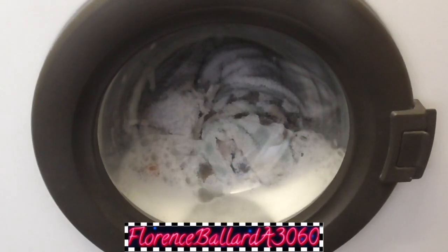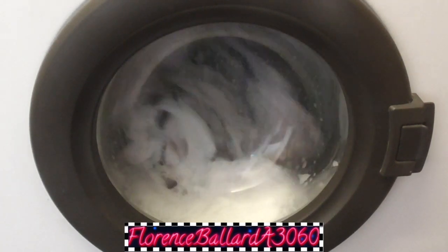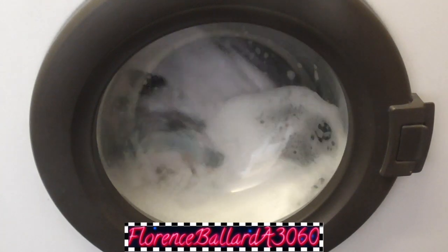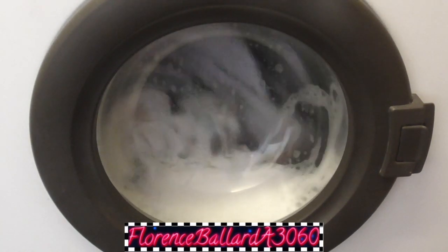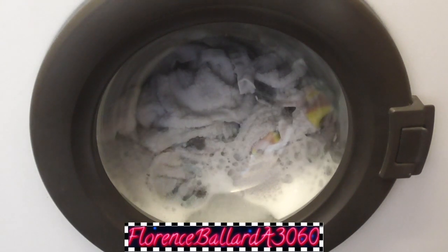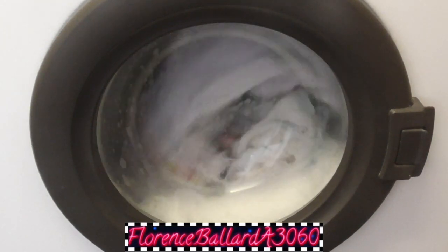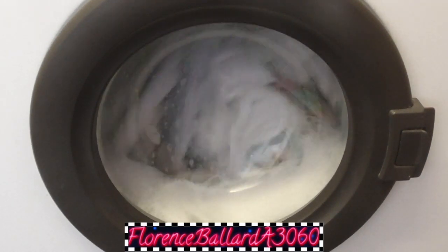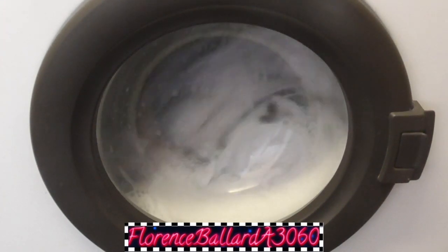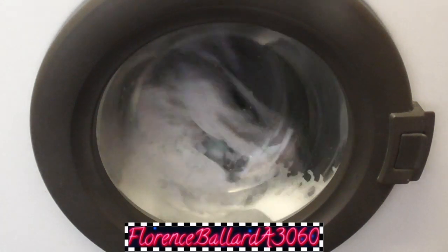We're looking good and we're at 85 degrees Celsius. And it took about 20, not even 20, yeah, about 20 minutes to heat that. So you can see the suds are becoming more active at this temperature. Weirdly, this machine doesn't steam from the drawer for some reason. Might be because the machine's got a later 9.5 style drawer housing. I don't know.